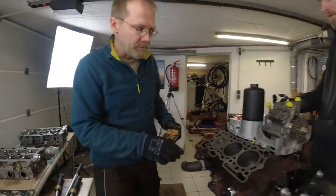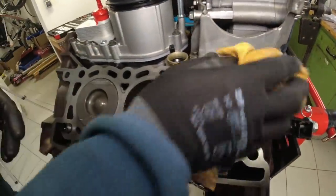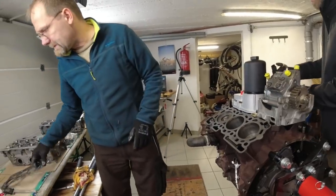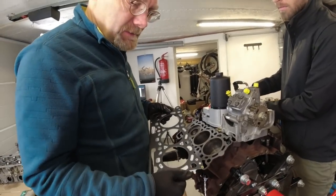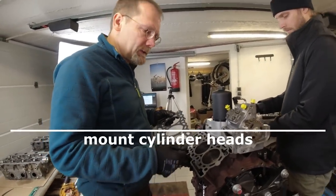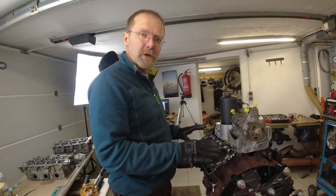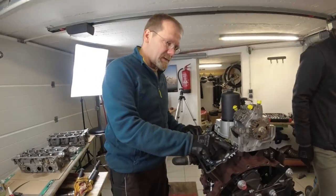Now look over here. These two bushings gotta be inserted first. And of course the face gotta be clean. And now here I got the gasket. Oh my. And remember we calculated the number 2 size gasket and we were only like 1/100th to the border of a 3. Because a 3 was installed originally, we're putting back the original size. But we're only talking about 1/100th. But we put in new pistons. Yeah, but it doesn't matter.